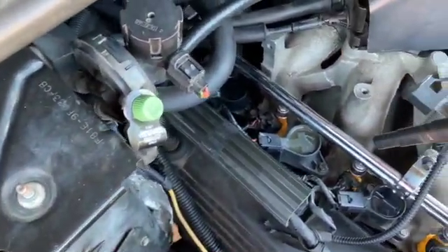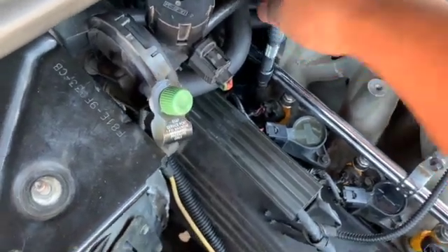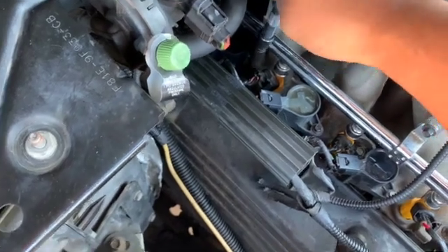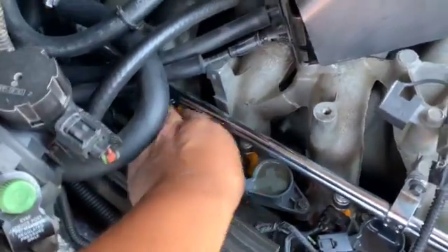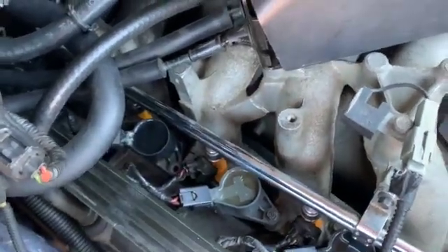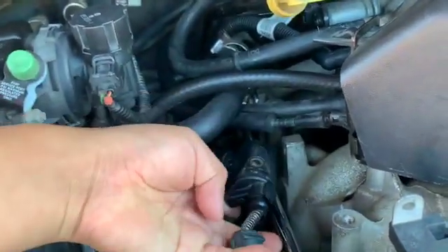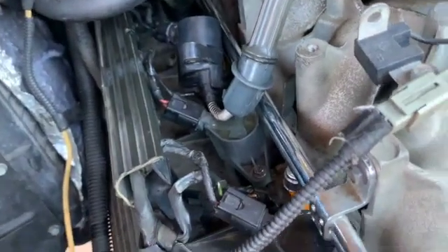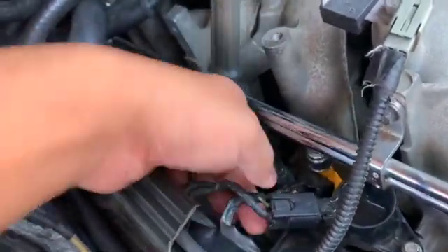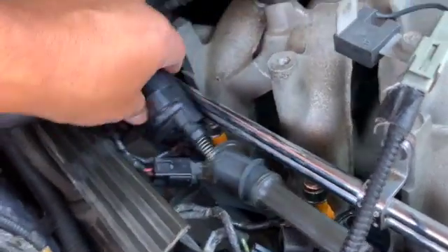For that one it's a size seven. Let's go ahead and loosen the bolt so we can pull out the coil. Each coil is roughly about 60 to 80 dollars, and this has 10 coils, so go figure. Let's pull it out - disconnect it from the electrical connection at the bottom. You can see it just came off easily. We need to swap it with cylinder one, so disconnect that one too - it's at the bottom. Pull it out.